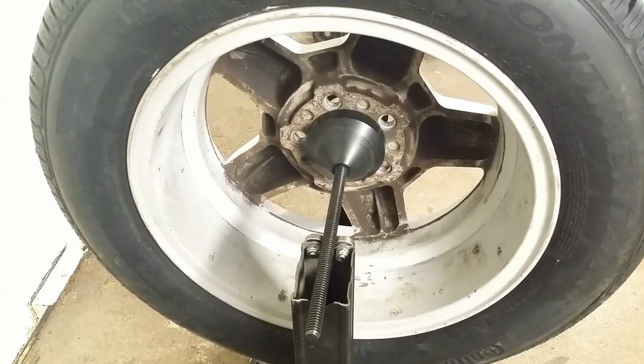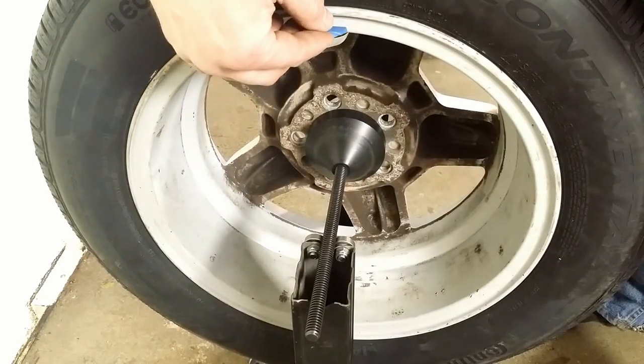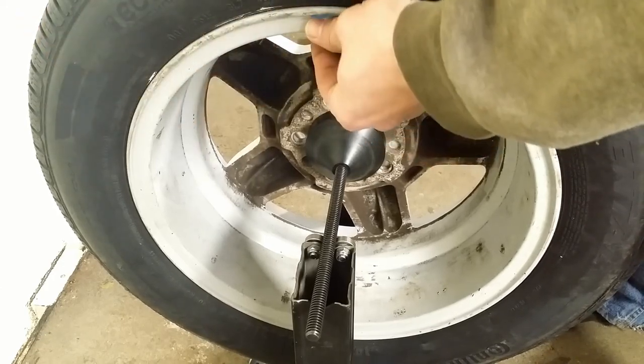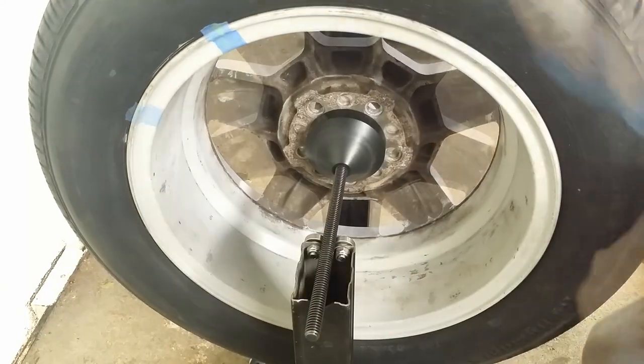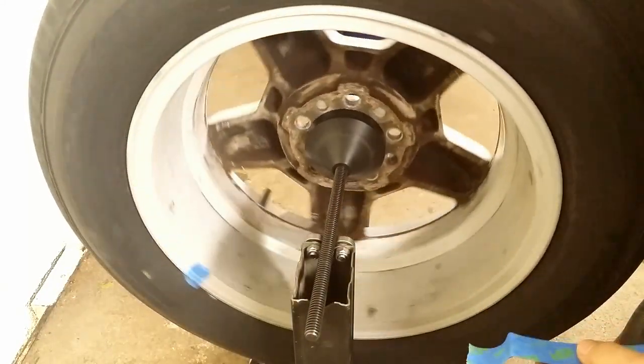When the wheel stops moving, I mark the lightest point. I use self-adhesive tire weights. But first, I use a tape to determine the right weight.